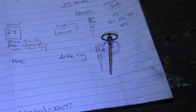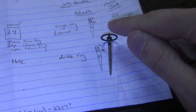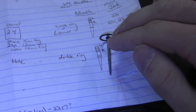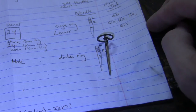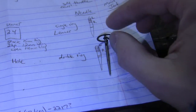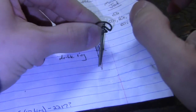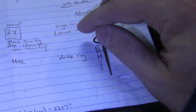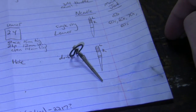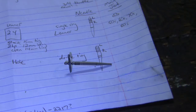The final adjustment is the needle clip setting. There are notches on the needle and this little clip goes into those notches. The higher settings are leaner settings, and as you move the clip down, it gets richer. When you're moving the clip down, the needle is going to hang a little higher, allowing more fuel through — that makes it richer. While the rule of thumb is that your clip setting is going to affect three-quarter throttle the most, it's worth trying every setting whenever you make a big adjustment, just so you know your carb is running its best.